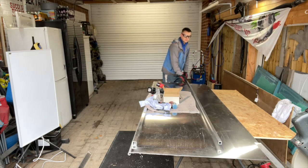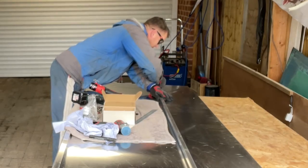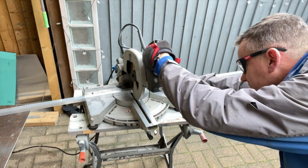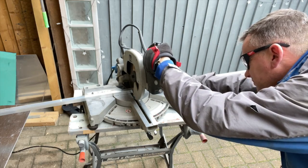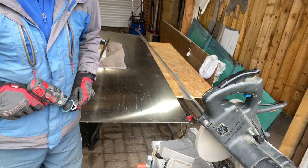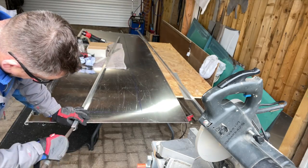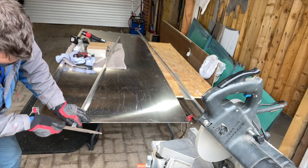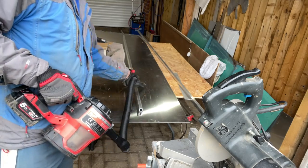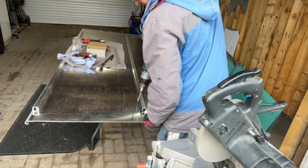So this is what we've got to work with — we've got some 20mm box section aluminium there, and we can cut that up, mark it, get it right. This should be strong enough to give us a decent amount of strength on that flap without too much weight. Just take the sharps off the edges, give it a little clean up inside of a square file. Lovely. Working clean — you don't want to get any burrs up underneath it before we rivet it down.